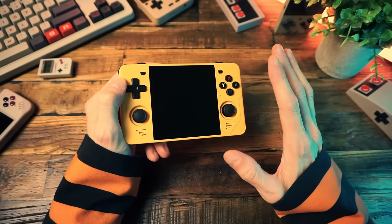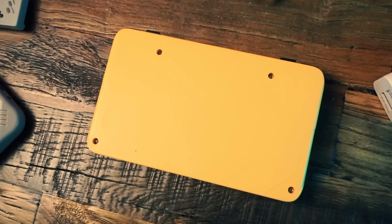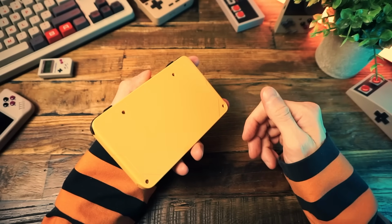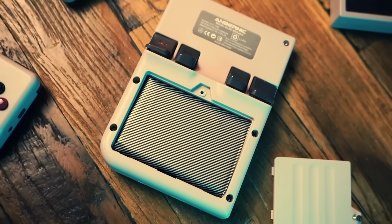So what you gotta do there is to unplug the battery for 10 seconds, which will force a reset on the battery controller. And that might involve you opening up the device to do it, by the way. It's a pain in the buns, but it's what you gotta do on some of the more problematic handhelds. If you ever get a device with a battery that just seems all weird and out of whack, just do the unplug thing. That fixes it most of the time.